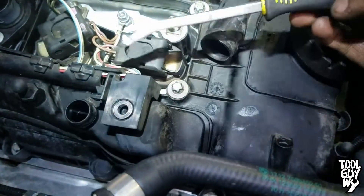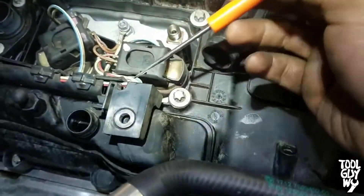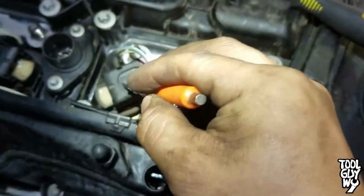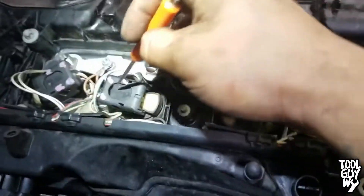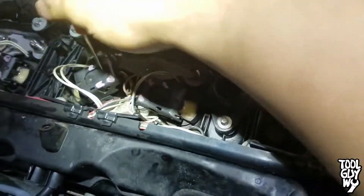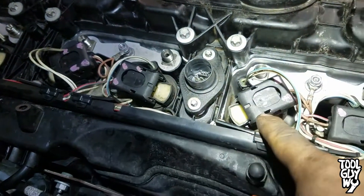Just take some pry tool — maybe a pry tool like this or a pocket screwdriver — and just wiggle it. See how there's a space over here? You want to try to get that space gone. Just do that and you guys should be good. That's a little quick tip for you guys whenever working on BMWs and you touch the coil packs.